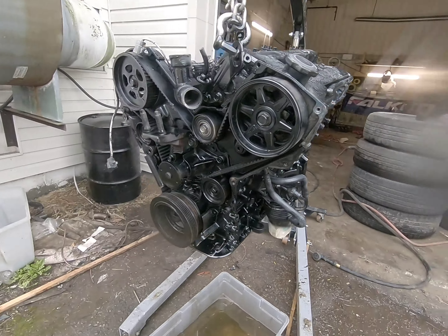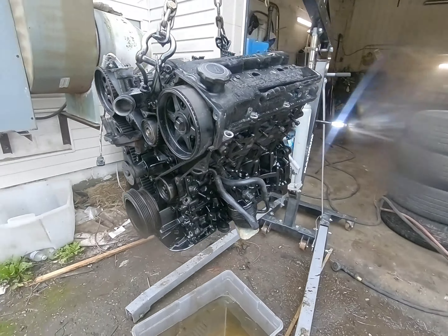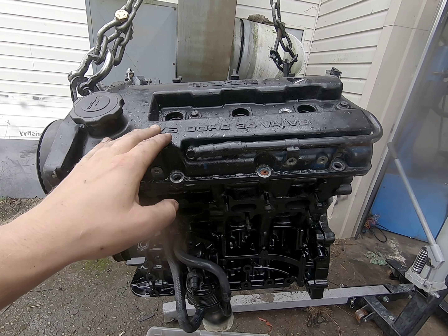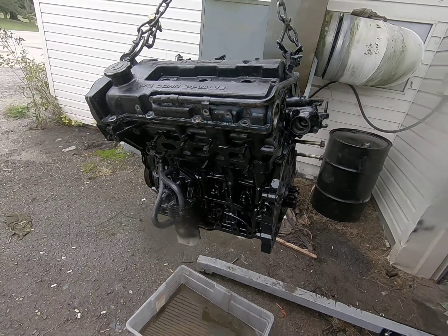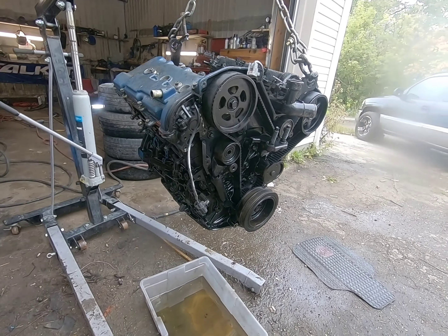She's all painted up. I don't have the valve covers on obviously — that's for the future. These are just covers to stop water from getting in. I'm going to put the new valve covers on with new gaskets, so that's going to be sealed. All the gaskets that aren't underneath the head gasket, I'm going to be replacing just so I don't have any leaks — that stuff's really annoying to me.